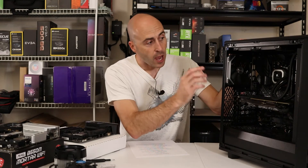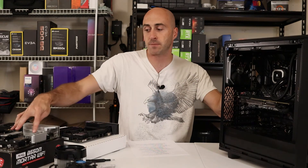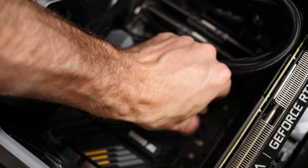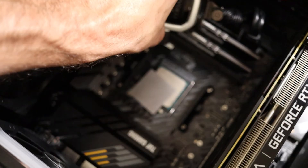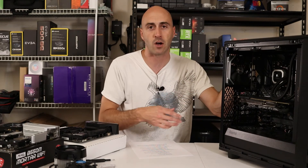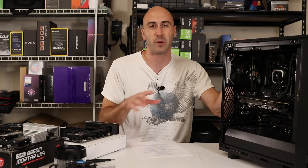For my upgrade PC here, I use the Corsair H115i Performance RGB cooler. It has a totally different mounting system than both of these — it has its own clip retention system that hooks onto the AMD mounting points, so it's kind of a hybrid system. I don't unplug everything; I just loosen these two torsion screws, which lets it go enough that I can swing those two clips off, and then just lift the CPU cooler off. I'm using a thermal pad, not thermal paste, just to make cleanup easier. There's really no difference in performance — I'll leave a link in the description if you're interested.